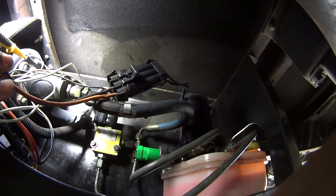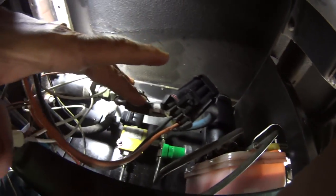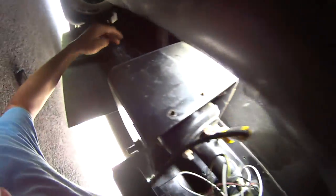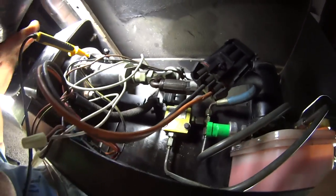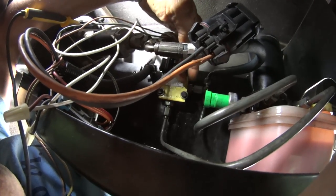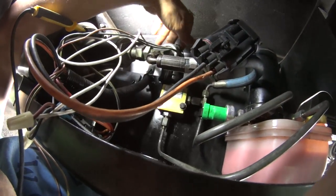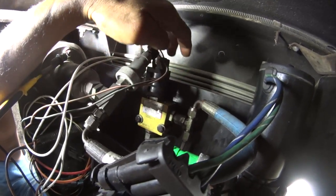your pump. Your pump will start again, pushing power through the pump, through this hose, to drive that ram inside there that will release the parking brake, the transmission brake. Back here in the very back, again, you're looking at a diverter, if you will. It may be an overflow when the fluid comes back. When you put it in park, it's got to come back into the tank. This will release this cam up here, so now the direction of flow goes back in.